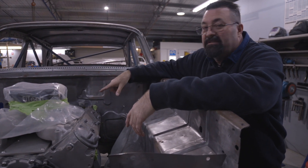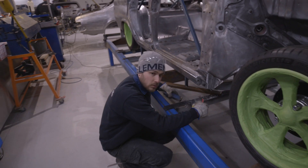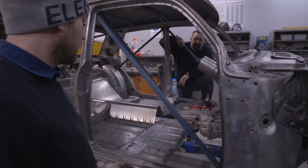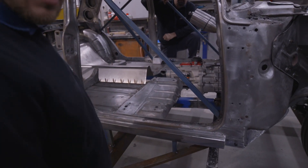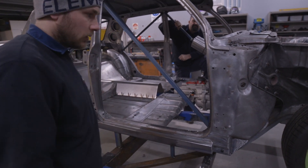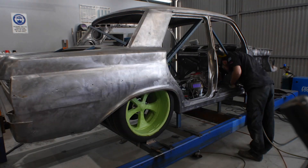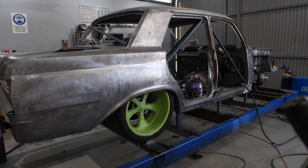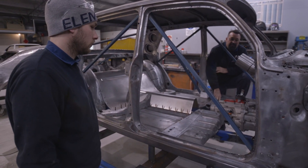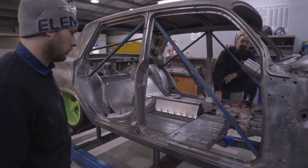If you want to spin over there, Dean's just working on the chassis rail - go have a look at what Dean's doing. Dean, can you point to the area you're working on? I'm just replacing the lower A-pillar, all the internal structure, and the front of the sill. The front of the sill on both sides and the A-pillars were rusted out. We also had to strengthen it up, because now that we've got all the cross-members and cross-bracers going through here, these are fairly weak cars. Once Dean's done all the cross-members and rust sections, he'll run all the exhaust through it.